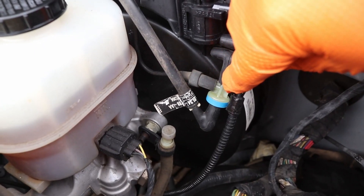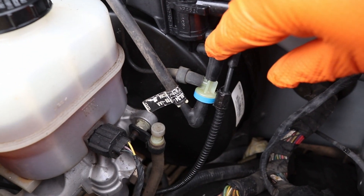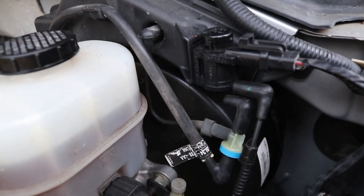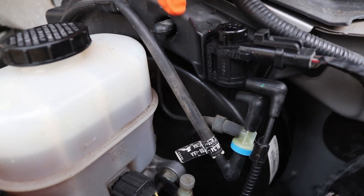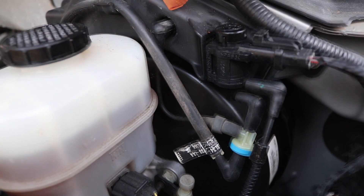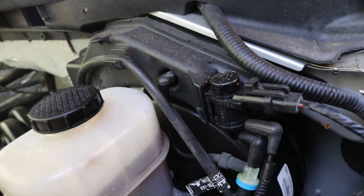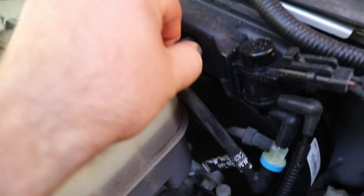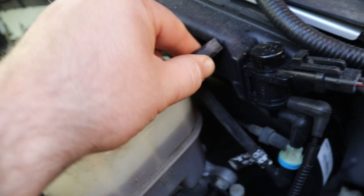Right here you do have a check valve. This is a one-way valve so vacuum is allowed to come in but should not be allowed to go back down and out. To check your check valve, pull this off right here, go into your vacuum tank, and if you heard a lot of vacuum escaping then you know it's good. After running it and letting it build vacuum, as you can hear it had vacuum in there so we knew that was good.